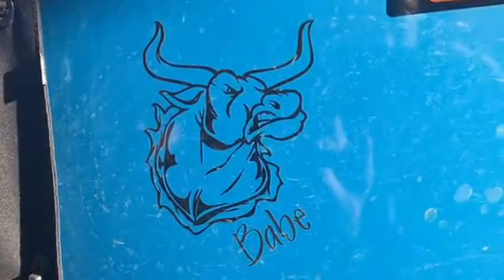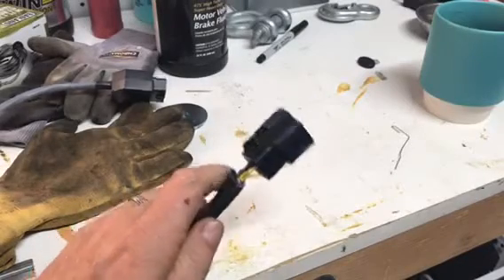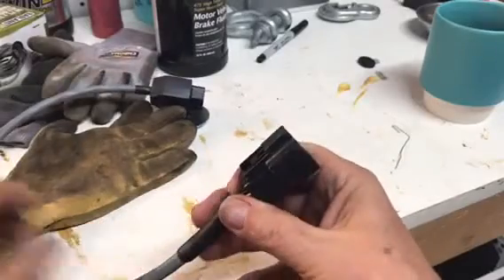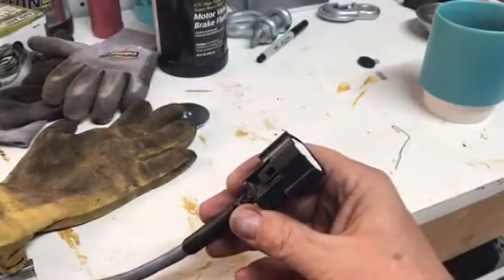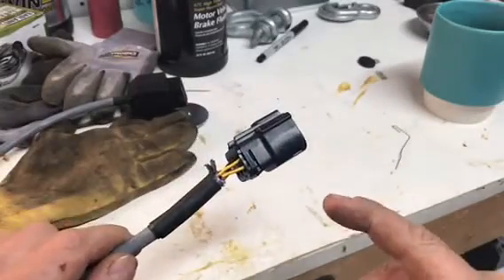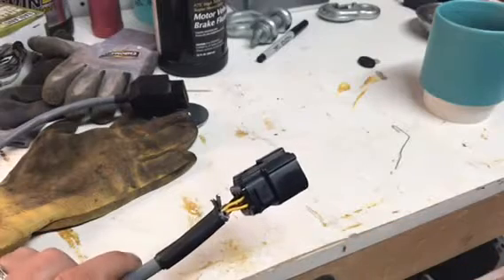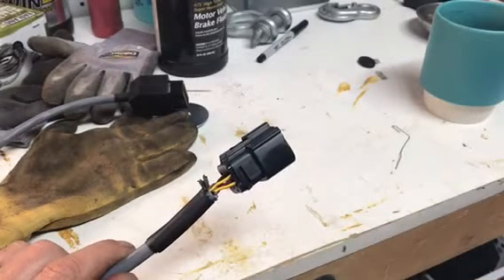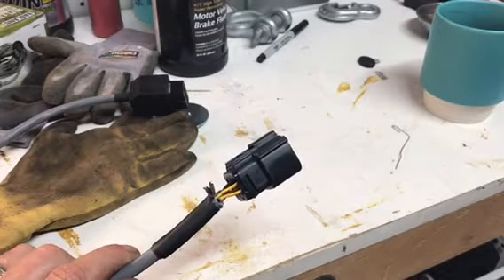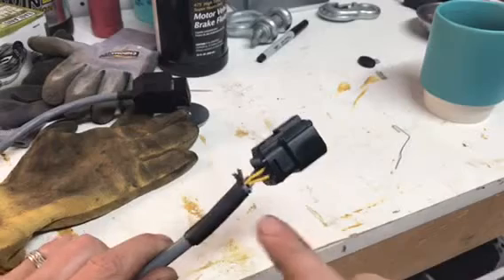Blueox Productions presents how to swap the pins on your OBD cable. The cables I built — I've been told that in the retro models and maybe in the M70 models the power and ground wires are reversed on the bike. So this is your situation; you should check it first with a meter on your bike. It's an easy fix on the cable and I'm going to show you how to do that right now.